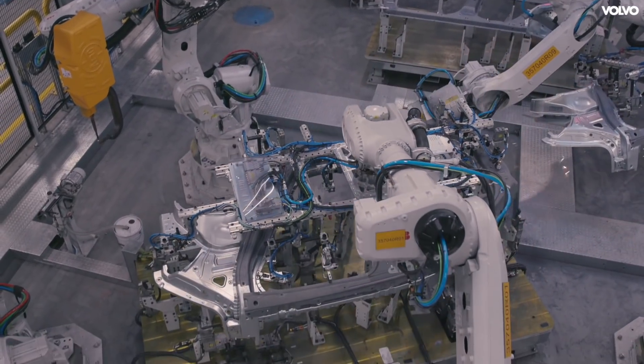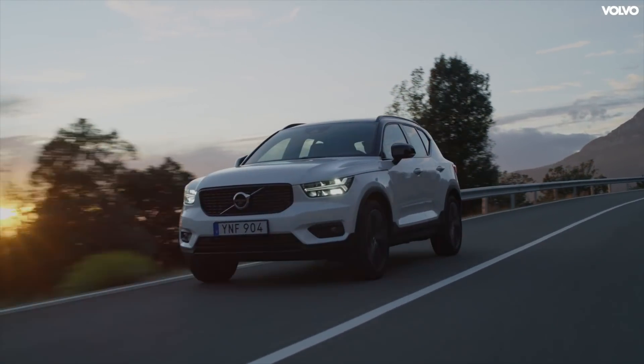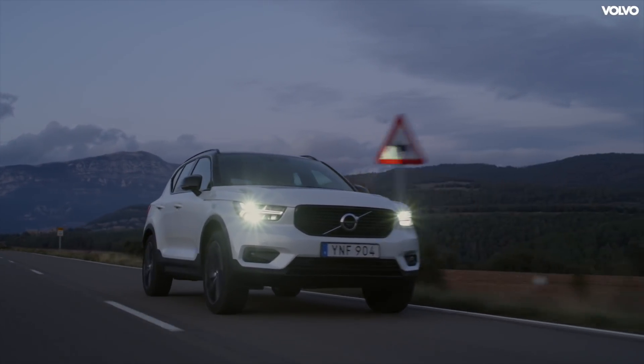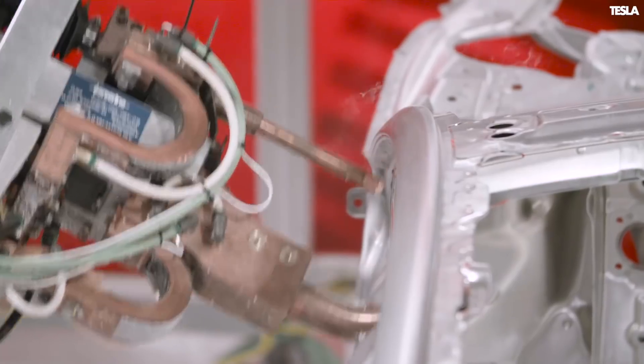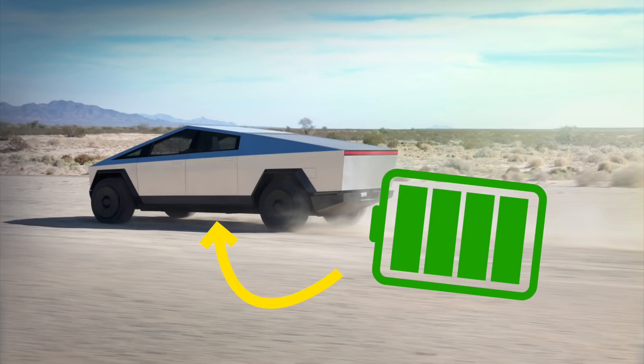As a result, most of today's cars are a uni-body design, where the body itself is integral to the chassis. Since the body is designed to be the core load-bearing structure, this solution is much lighter than using a body with a separate heavy steel frame. The Cybertruck uses a uni-body for this very reason — lightness whilst also giving more room. This decision is down to a challenge normal trucks don't face: where exactly to put the batteries? A chassis-on-frame design would result in the steel chassis structure occupying the space where the batteries should be, low down in the floor. So the uni-body design means the batteries can fit into the floor whilst the entire body carries the load, rather than just the frame.